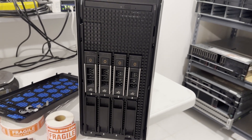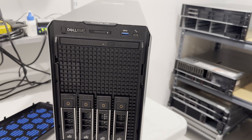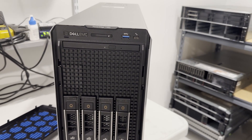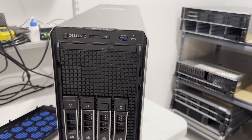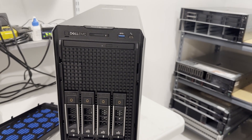On the upper left, you'll find a power button, followed by an informational LED, a USB 3.0 port, and an iDRAC direct port. The system also includes an optional DVD drive. Since this system lacks an optional BOSS S2 module, we'll utilize a dual-port Dell BOSS card equipped with two M.2 modules.